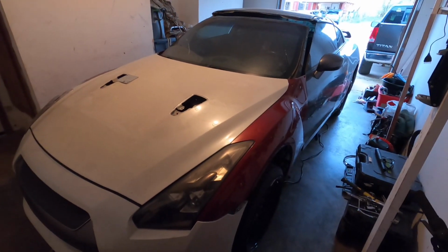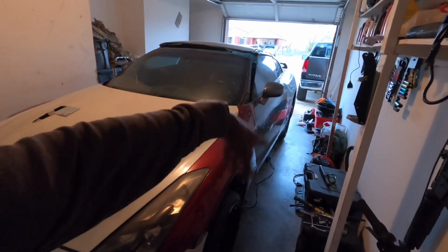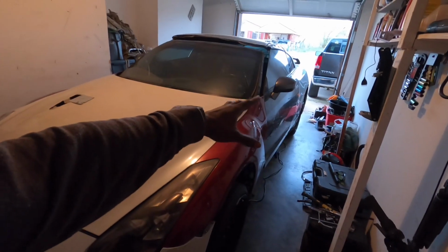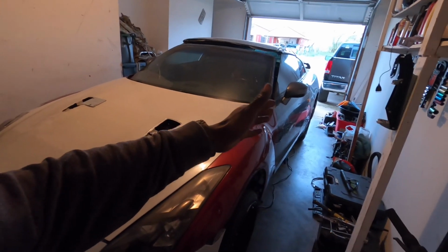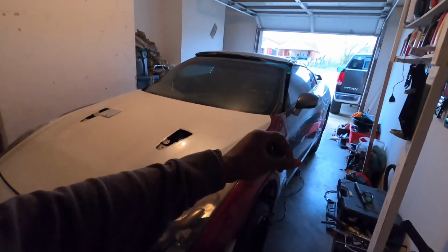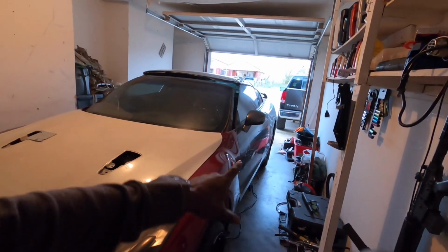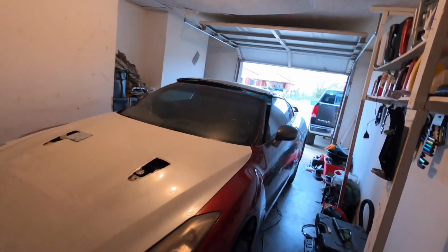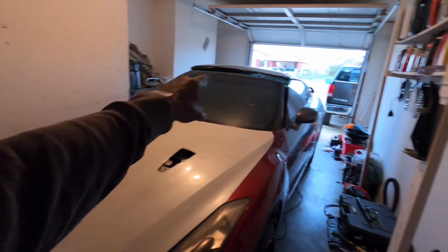And then once it's able to get welded, I can worry about the rear trailing arms, rear lower control arms, upper control arms. All that's got to be custom back there, so I can move the wheelbase about 2.8 inches forward to shorten it like the R35. And once I do that, everything is gonna be sheet metal welding. I'll have to do sheet metal welding in the fender wells, get that done, weld the trunk portion sealed together, add some seam sealer.